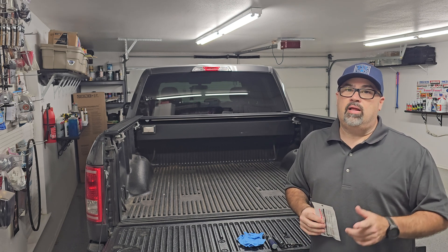Let's get this thing put back together — I'm curious to see how it looks and I'm really glad we did this because I had a third brake light out. I've gone ahead and put all the screws in without tightening any of them — just got them down to where they were touching the lens until I got all four in. That way I didn't have to try to line anything up with the screws being tight. Now I'm going back through to do a final torque, tightening these down and making sure the lens is flush up against the cab so I don't get any wind, rainwater, or power wash water penetration on top of the cab.